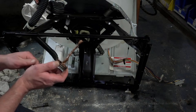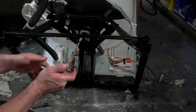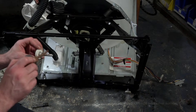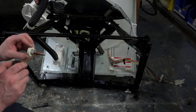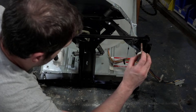So with the legs, I use a little bit of anti-seize, and I'll put a thin amount at the very bottom, and then I'll back that locking nut so it lives in that anti-seize. And then I'll take a larger amount and coat the whole thing, which I know is a bit overkill, but if you've never had a stuck direct drive leg before, let me tell you, they're a real pain in the butt to get loose. Hopefully this will dry in place and be there for eternity.